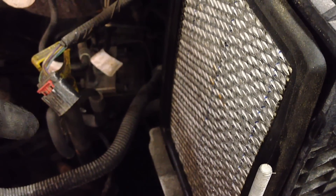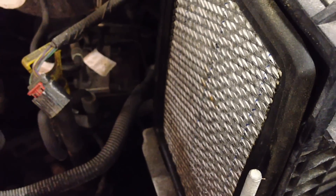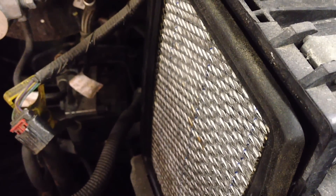The other thing this time of year is if they collapse like that, they'll go way in and just be shoved in. That unfiltered air coming past it won't only bring dirt — it'll bring snowflakes, the light blowing snow. We just had a blizzard; that'll come through, shock the hot wire on the mass airflow sensor, and shut you down also. I just had it yesterday on a Super Duty. It's very important — as much as having a properly working electronic throttle body — to have the air system completely sealed as the manufacturer intended.